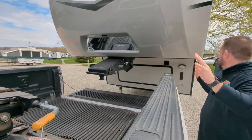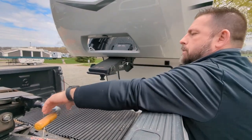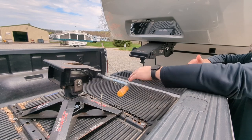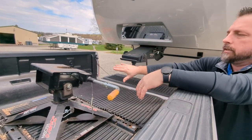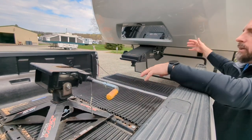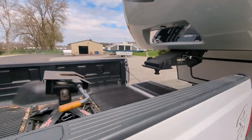We have nothing behind us, nothing in the way — we've made sure we're safe. The first thing we're going to do is lock the latch out, so now we're ready to drive underneath. When we go underneath, it's going to hit a trigger and this will automatically go in. Then we'll double-check to make sure that goes in all the way, pin it, and then we can move on to the legs. I'll go ahead and back this into the hitch so you can see that.